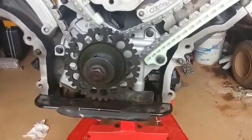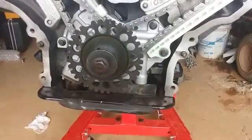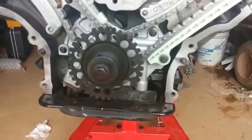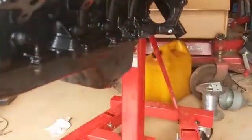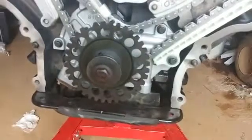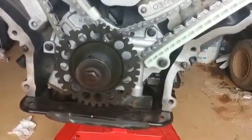Anyway, the tube was set up for a deeper sump pan, which I don't have because it's actually going in a 2000 Lincoln Town Car or Crown Vic type body. So mine wasn't configured with a deep sump pan. It's the standard stock pan. There it is. I did look online. It looked like the Mustang GT pan might have fit. It was almost the same configuration, but deeper.